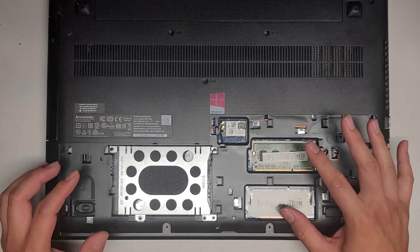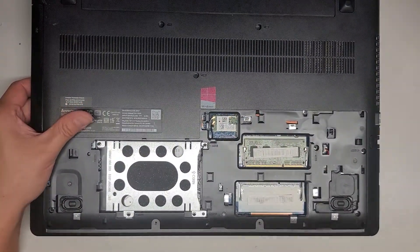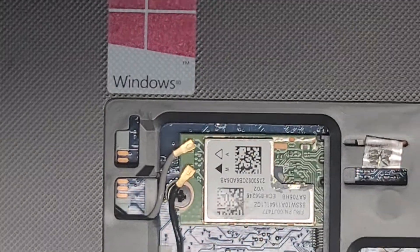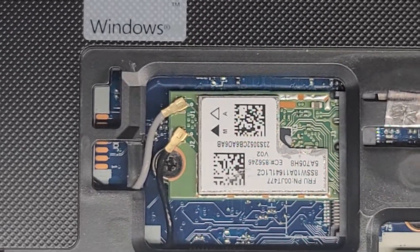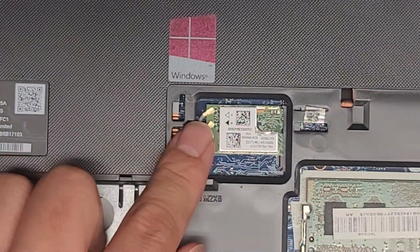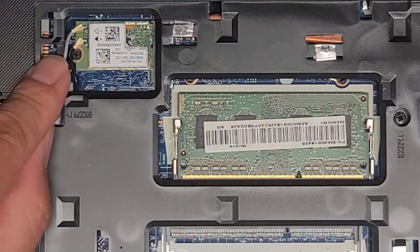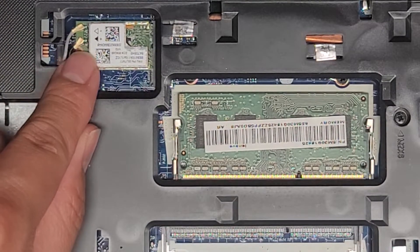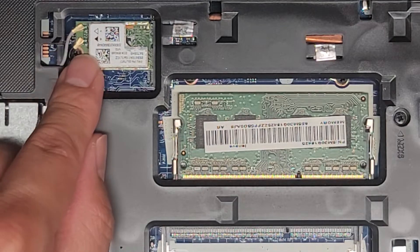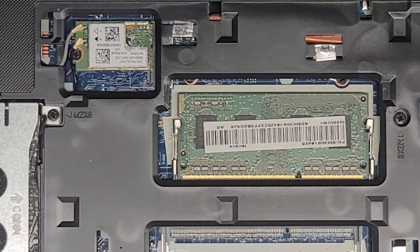Here you can see there are two slots for RAM. I'm assuming this is the CMOS BIOS battery connector. The wireless card is here, so you do have access to that. Just like every other model, there's one screw — it pops up at an angle and then you can pull it out. The wireless antennas you do want to pull up from the tails. I have videos showing how to do that for other models. I usually don't do it because sometimes the solder points for the connectors are not good, and I've had some where it rips off and gets stuck in the antenna connector. It's pretty rare, but it does happen. So I don't want to do extra work when the customer just came in for a hard drive upgrade.